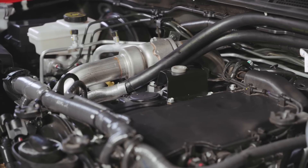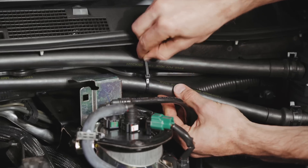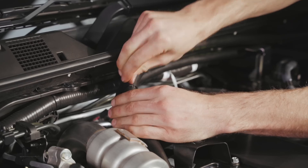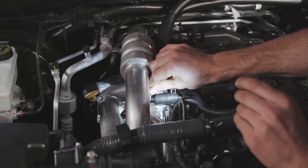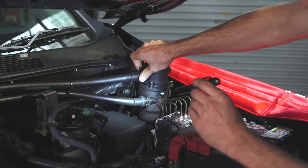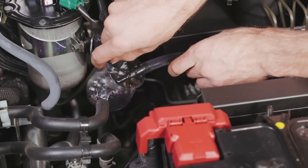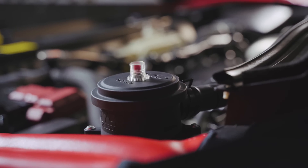Finally, do a quick once over to check all items installed. I recommend you use cable ties in areas that will support the hoses, as this is best practice for a neat and tidy installation. Once you are happy, start the engine and check for any possible vacuum leaks from the hoses and connections that have been installed. Remember to drain your catch can every 5000km and service the internal oil filter if the red indicator on top of the catch can is raised.